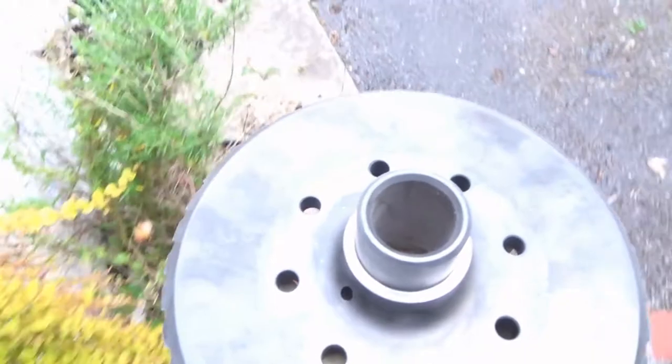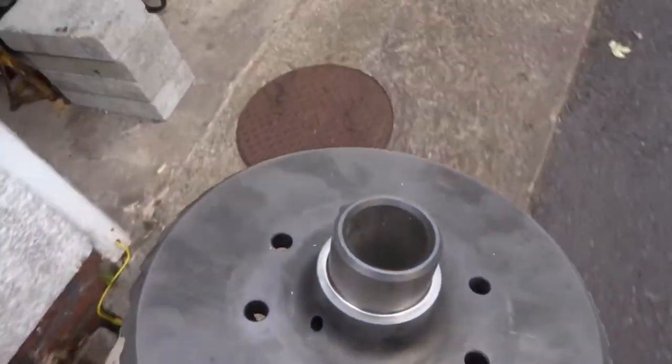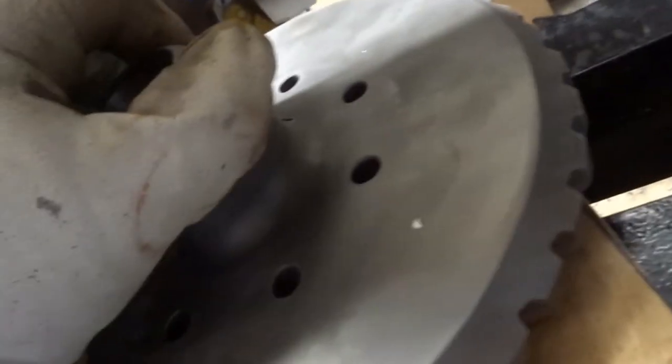There we are - crown wheel from the freezer. This will get covered in condensation now - you can see the ice forming on it. I'll put it on this wood. I'm using a glove, it's trying to warm it up with my body heat. Right, now we'll go and get the warmed-up bearing.